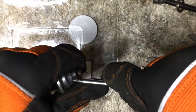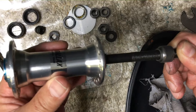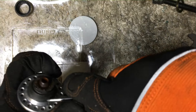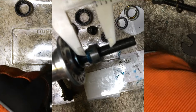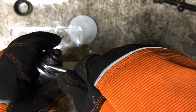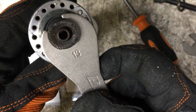To accomplish my task, I need a really long rear axle, and I have one from a hub that I stripped a long time ago. It should fit, but what I'm going to do is test it out on this Shimano hub that you see me struggling to get the dust caps off of — just to make sure that the compatible cones will fit inside the hub and work with the smaller bearings. I'll find two cones that are the same length so that we have a uniform base inside of the hub.